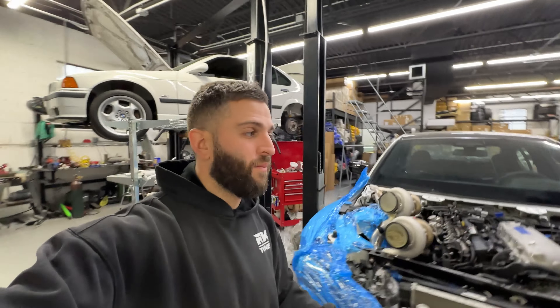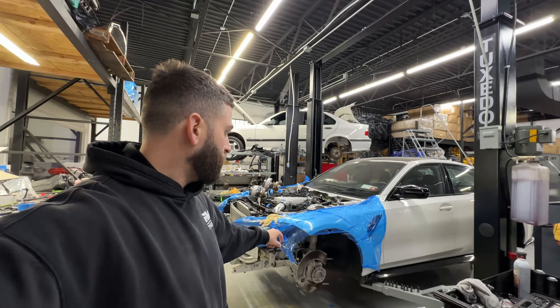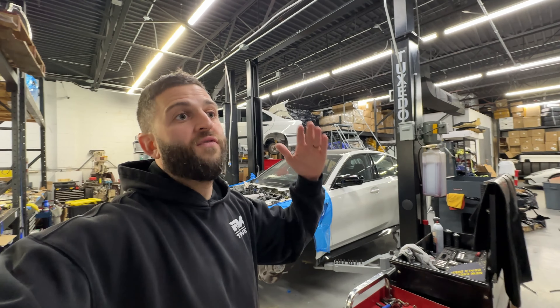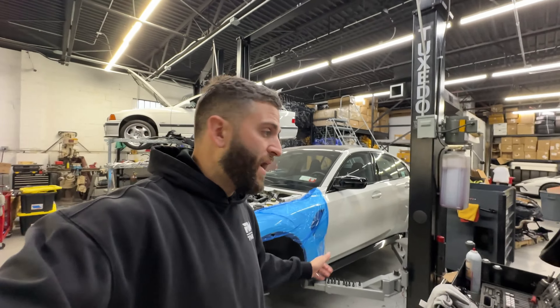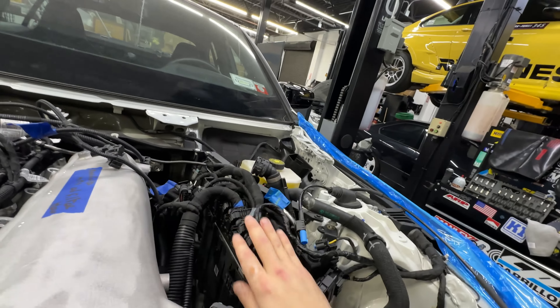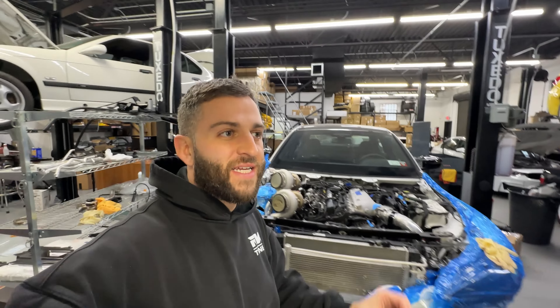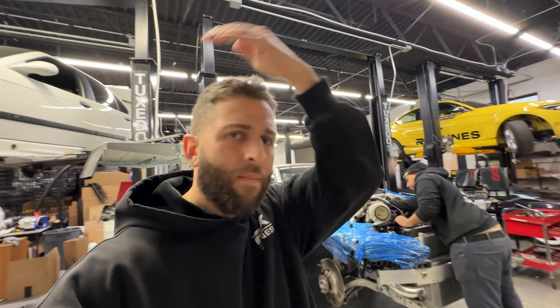Cars don't have crazy anti-squat, so we use some level of weight transfer to help and then hopefully not just drop right back down. We'll do their stuff in the back also, so I'm waiting on that coilover-wise. ECU-wise, the car is getting set up. For intercooler size, I went with Treadstone — I think it's a 1260R. It's six inches thick, 12 inches tall — big boy. We have a separate video on the entire motor build and breakdown.